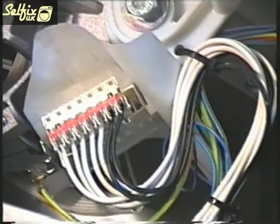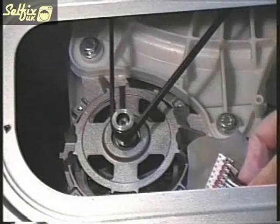The wiring plug from the motor is attached to a socket. Take note how it fits because some, like this one, have an extra vacant position that would allow you to refit the plug in the wrong place. Now remove the plug and earth wire.